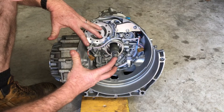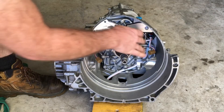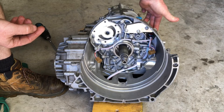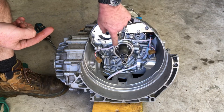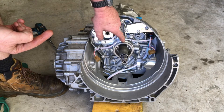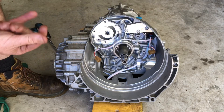Once all that's done we can start to unscrew all of these and the plate will just pop off. To disconnect the electrical harness, push the plug in from the top after removing the silver clip at the top, and then there are a couple of clips holding the harness in place. My advice is to take a photograph of how everything fits together so it all goes back in the right spot.